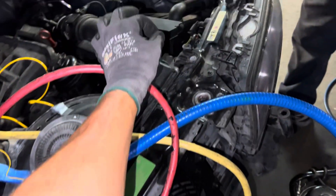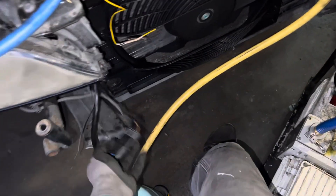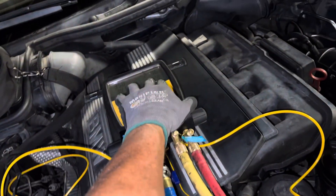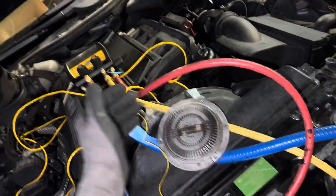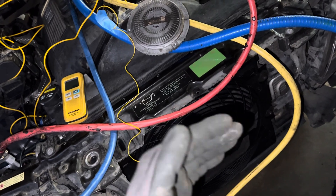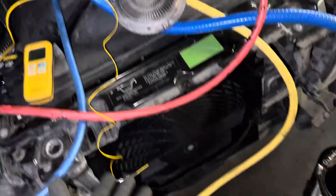So when you want to condemn one of these and you have both fans working at the same time — some BMWs have a pressure switch that won't even allow the electric fan to come on until it hits 270 psi. What you'll want to do is disconnect the electric fan if it's easy to get to, and just wait for your coolant temperature to heat things up. You'll notice the thermal clutch never locks up one-to-one, never spins really well, and allows your high-side pressure to go over 450 psi. And you'll think your engine isn't overheating — the thing is, radiators are so overbuilt they don't need much airflow to keep coolant temperature in check. But condensers are built right at the hair-thin margin — what they call the straw that breaks the camel's back. They'll go into thermal runaway, and once they reach that point they can't recover. You'll see the pressure go right up to 450 psi. But right now this is doing really good.